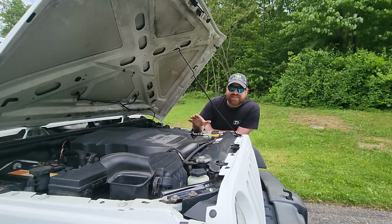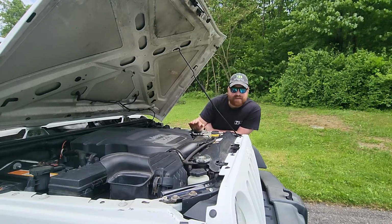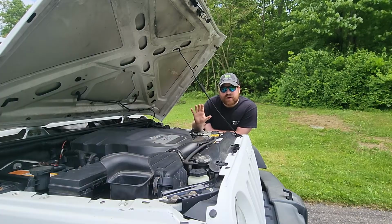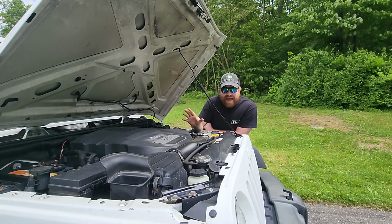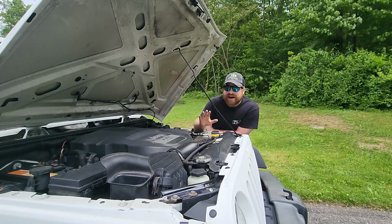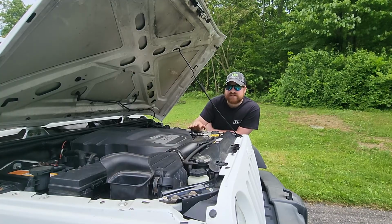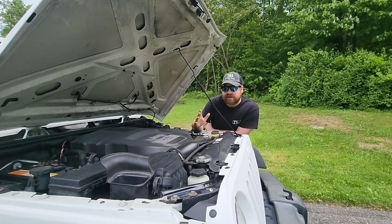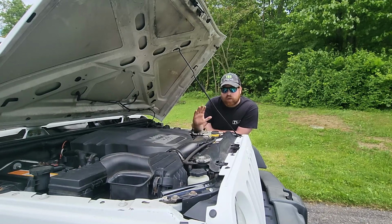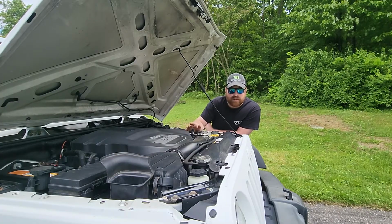Now, under the hood here, we got the 3.6 liter Pentastar that is very popular across Chrysler products. These V6s are kind of tough for me, because they're okay engines. The oil filter housing, very commonly cracked, probably the most common problem. Valve train issues or noises, pretty common. Cam issues. Those are probably the big issues with this engine. Some oil consumption stuff, some oil leaks from valve cover gaskets, things like that are somewhat common.